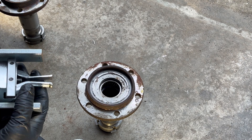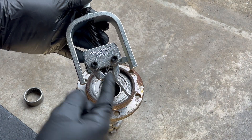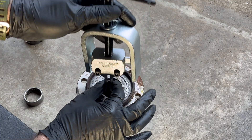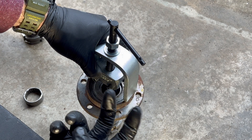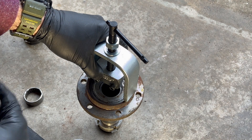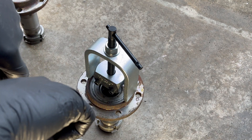The most typical way is with a pilot bearing puller. There's another type that fits on a slide hammer, but essentially you'll insert those down there and honestly the trickiest part is just making sure you've got those two things spread apart and hooked under just right. Otherwise you'll have multiple failed attempts getting them to latch, stay put, and then pull up.